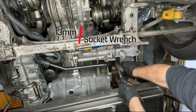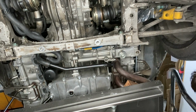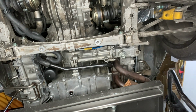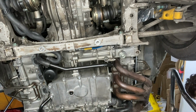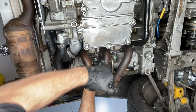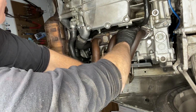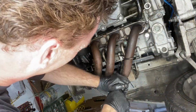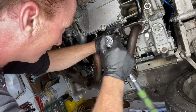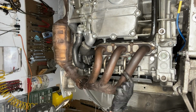But then really there's no future in having the hydraulic table there if I'm going to get bolts in. So I zip tied the headers to the muffler mounts, and that really worked quite well. It kind of got it all kind of close so that it wasn't fighting me too much. Once I was able to get that second bolt in, I was feeling like this was going to work. I'm not putting those bolts in tight, I'm just putting them all in kind of loose. And I'm using that wrench there to bend the headers into the position I want. That was a handy technique. Once I got all of those 6 bolts in loosely, I decided to move across to the other side.